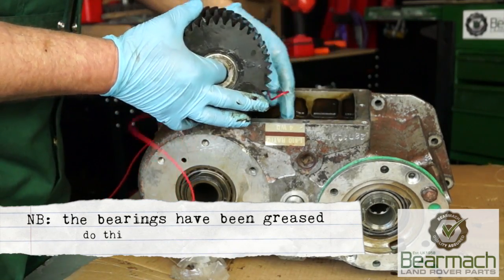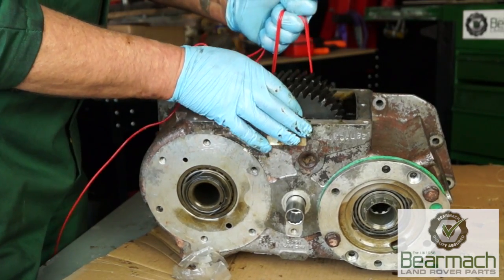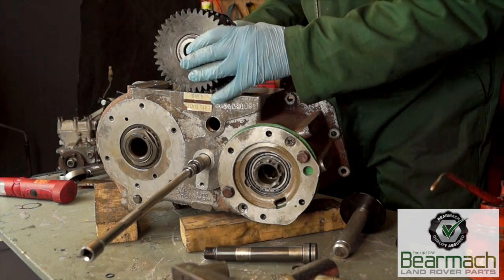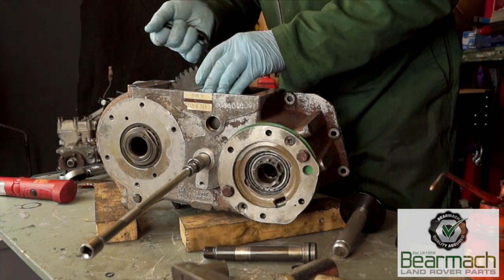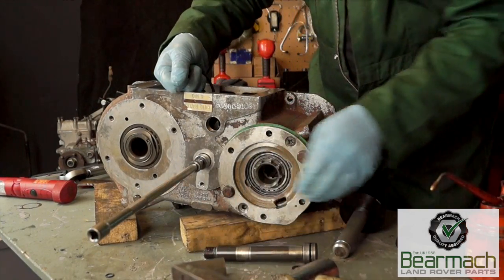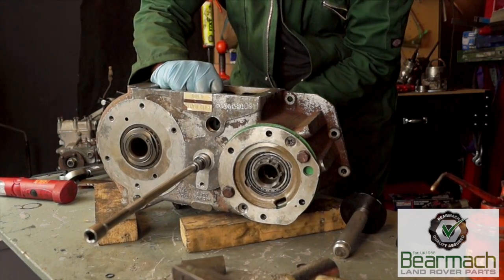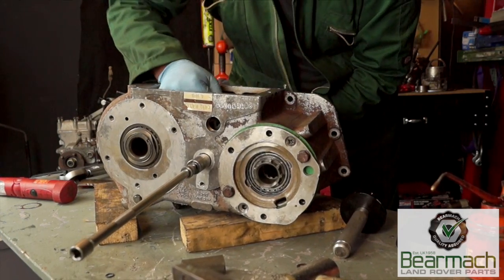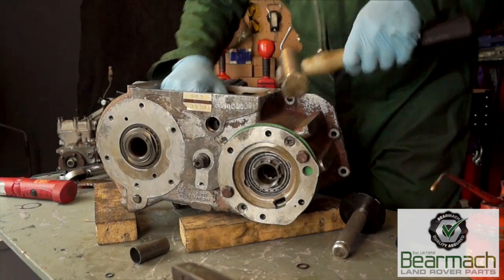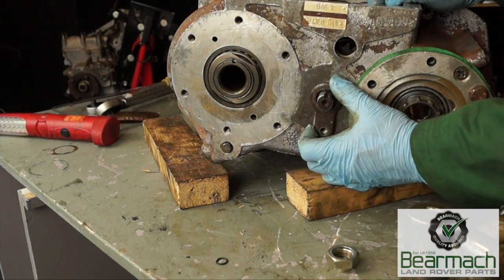To control putting the gear back into the casing you're going to use a rope or something. We couldn't find any rope in this workshop and had to use a piece of wire — basically you need something to support the gear as you drop it into the casing. We have a socket which fits through the pin hole at the back of the transfer box. As we drop the gearing into place we're holding the bearings there, using the socket as a support tool to push the pin through — through the bearing, through the collapsible spacer, and out the other side. There is normally a tool called a guide pin, but we're using the socket instead. Remember to remove your rope once done.